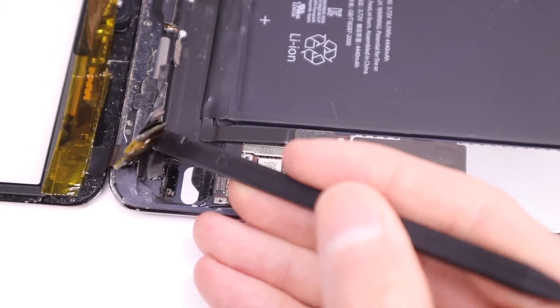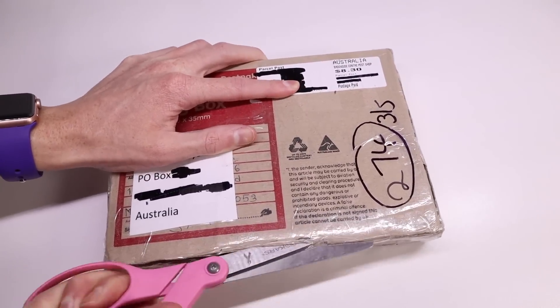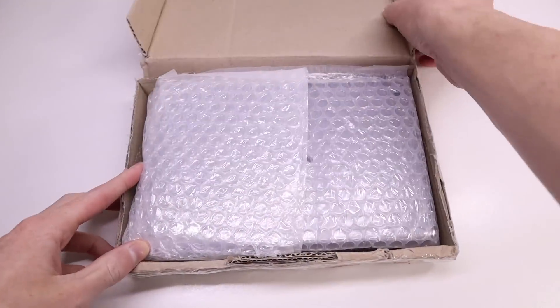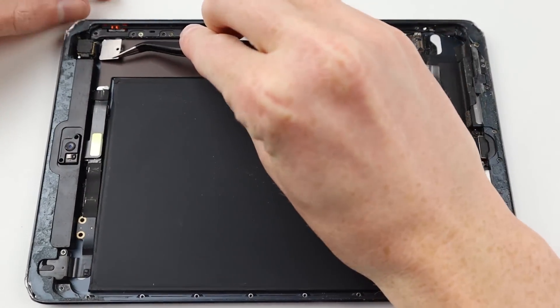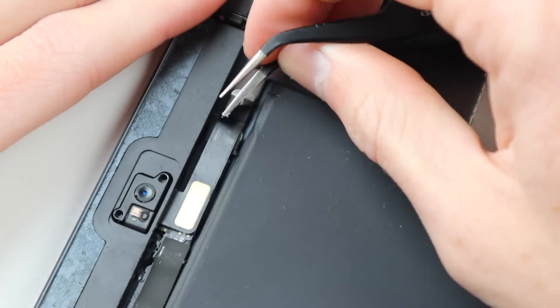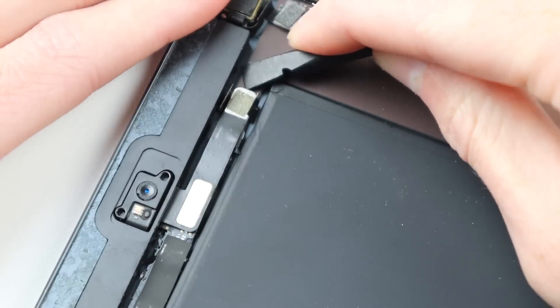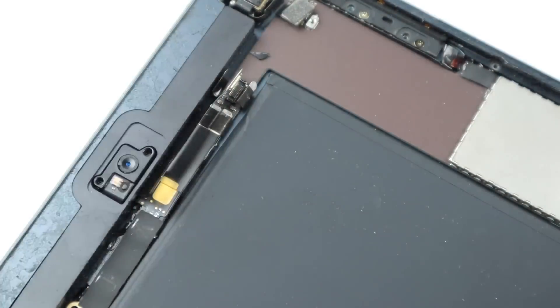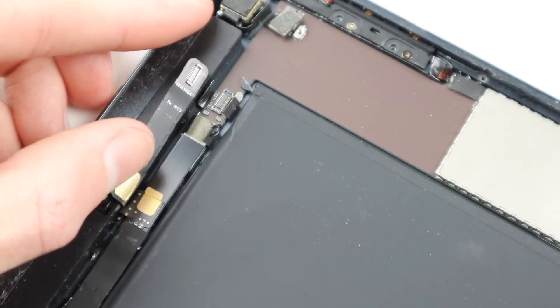For this iPad mini I'm also going to be replacing the housing, so I sourced a replacement housing from someone online. I also had a parts mini 2 which I used to restore the iPad mini 2 a few weeks ago. The reason this iPad needs a new housing is that if I install a new digitizer piece of glass — which is the top layer of the iPad's screen assembly — it won't sit flush and will allow dust to get underneath it, as the dented corners will keep the glass lifted from the metal frame.